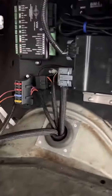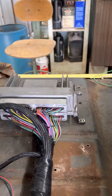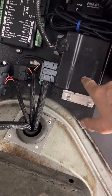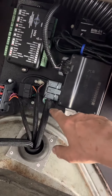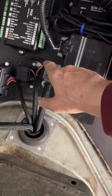This is all the ECM harness that's over here underneath the seat, goes down through here, up on top of the engine to run the transmission and the engine. It's got to go into this box, which is for the electronic gas pedal, and then this goes over to the pedal. That'll go up over — this is the check engine light and the diagnostic connector, and then that ties into this box here.